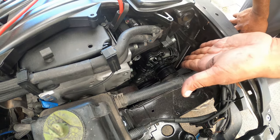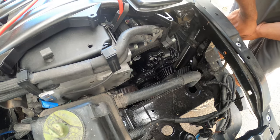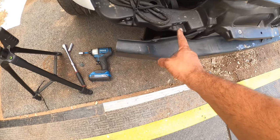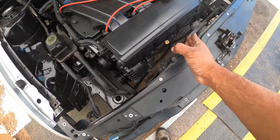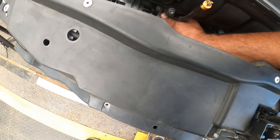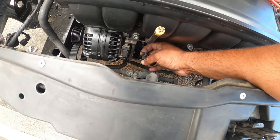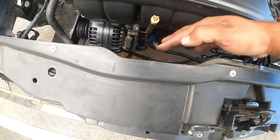Now we need to be able to yank it out — it's in a near impossible spot to get it out, so that's the whole point of getting the front end in service mode. By unbolting the top and loosening the bottom ones, we gave ourselves a pretty big gap right here all the way across and around. Now this allows us to go down here, unplug the main wiring, take the 13 off of here, and take out the alternator.